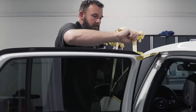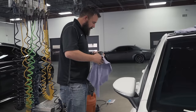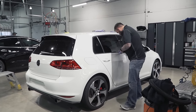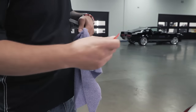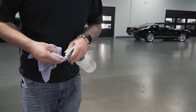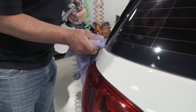If you're working on a car with finicky soft paint, it might be the exact opposite — the cutting session may be quick and easy while the polishing session takes a lot of time. Every car is a little bit different. After everything is said and done, go back and clean all the edges and cracks where polish and compound can build up. I use a plastic razor blade tool through every crease, emblem, and panel edge. Before applying any protection, remove any polish residue — leftover compound could jeopardize the effectiveness of your protection product.